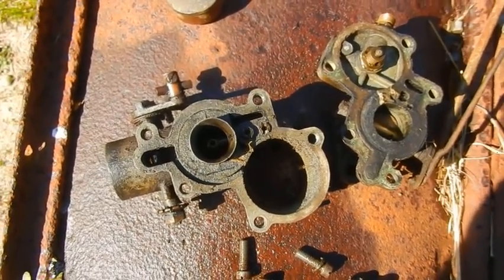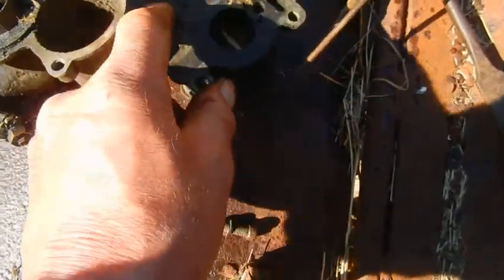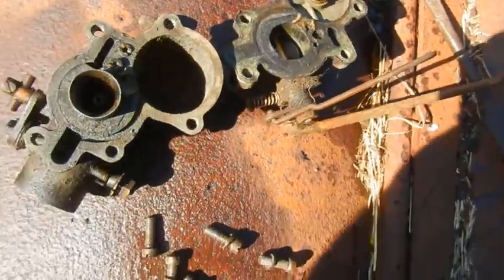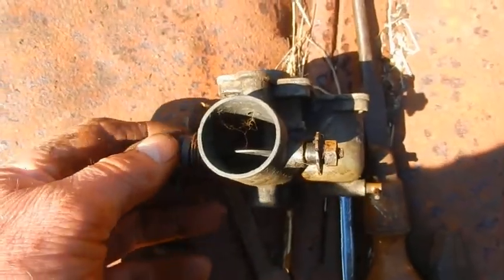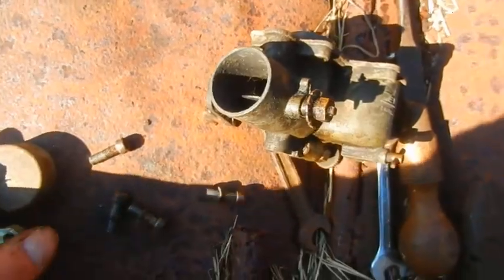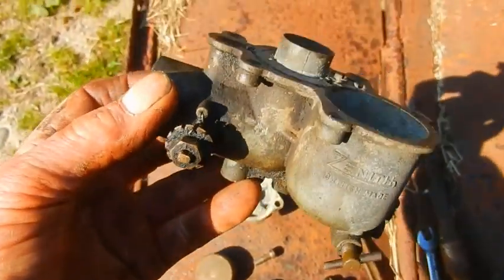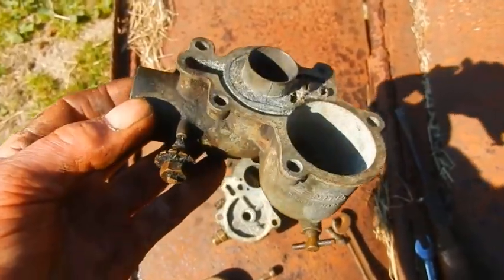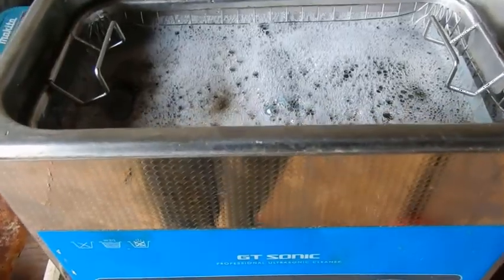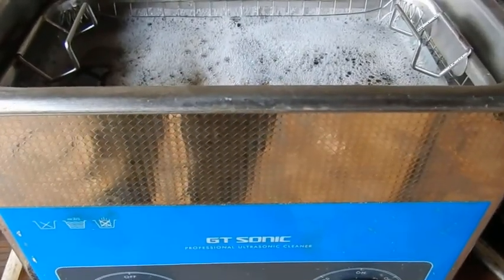In the future we'll renovate it and use a repair kit. There's a lot of play on the butterfly shaft, and the choke shaft had also seized up — I've got it moving. I've decided now what I'm going to do is chuck the whole thing in the ultrasonic cleaner for an hour with carburettor cleaner, and have another look at it later. They're going away now in the ultrasonic cleaner in a solution of carburettor cleaner.